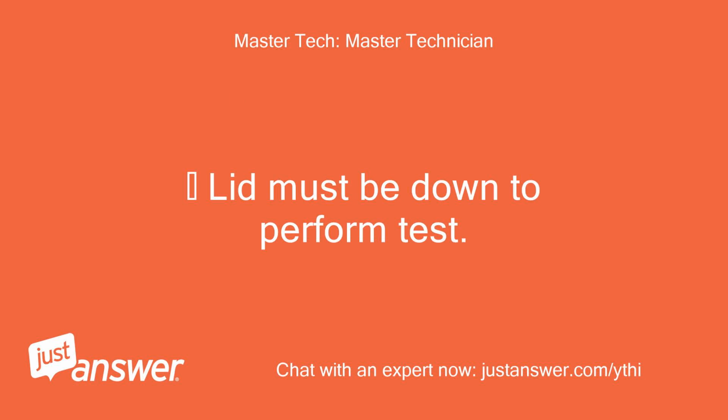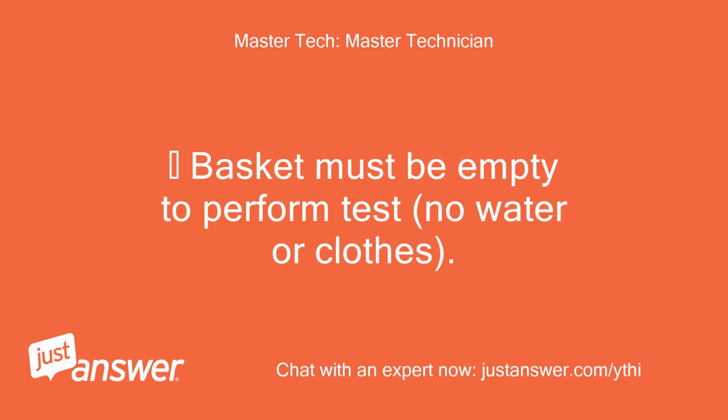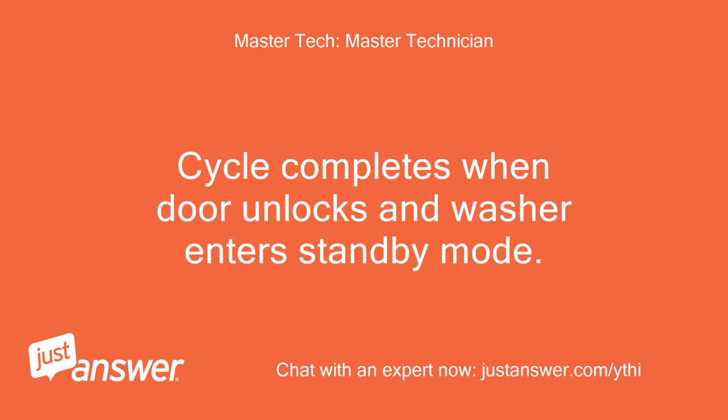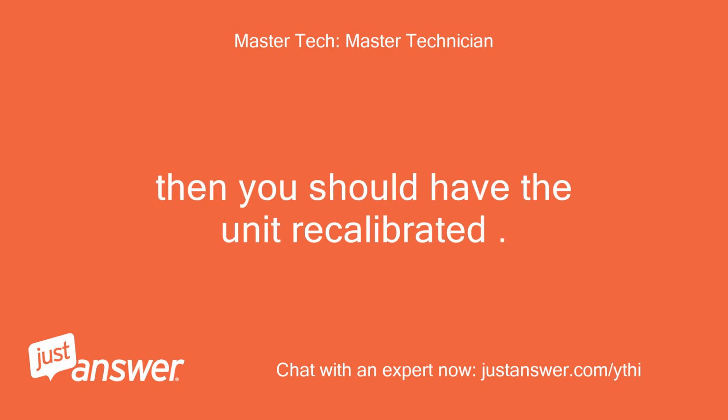Lid must be down to perform test. Basket must be empty to perform test, no water or clothes. Calibration cycle runs for approximately 2 to 4 minutes. Cycle completes when door unlocks and washer enters standby mode. Then you should have the unit recalibrated.